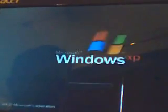Yes, so the HAL DLL error apparently has something to do with the boot.ini file, and my webcam's gone a bit red, sorry about this. Right, there we go. So the USB's gone, and as you can see now we have two options. It says Microsoft Windows XP Professional and USB repair not to start Microsoft Windows XP Professional. Now I'm not sure what the second one does, but I'm not going to start it. I'm just going to start the Windows XP Professional.